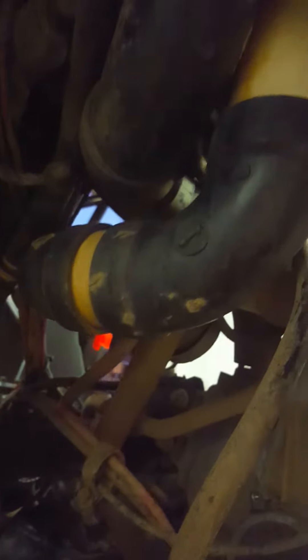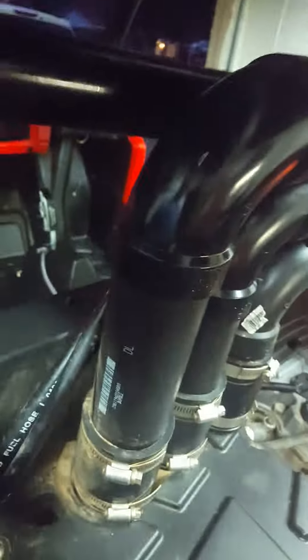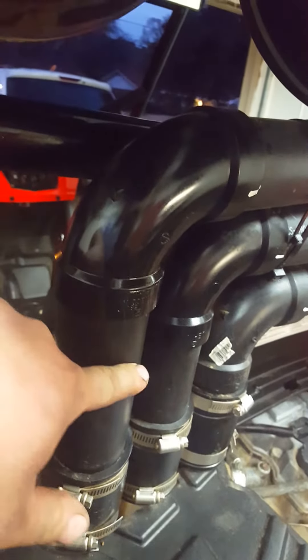For the belt exhaust, I added a three-inch to two-inch rubber coupling right here to a 90 — that's the white piece right there — and that's going to go above your belt intake. Then from that white two-inch piece, to a 22-and-a-half, back down below again to a street 45 to a 90 degree, and then straight up to the outside. So you've got belt exhaust, belt intake, and air intake all going up.